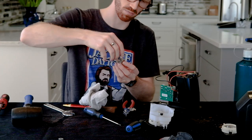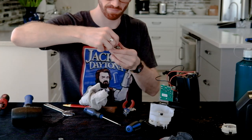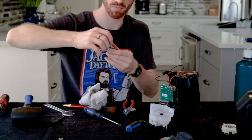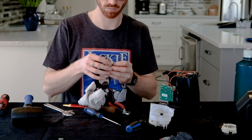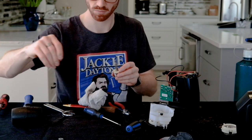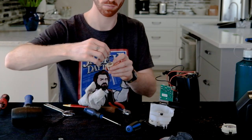The rest is pretty hard to mess up — you just reassemble it with the new burr. Don't over-tighten this, just finger-tighten it, because it will work its way on as it's grinding. Baratza specifically mentions that the paddle fits into a little groove inside the bottom of the burr, so that's nice and easy. Then you put your washers on, then your felt, and then you just put it back in the gearbox.